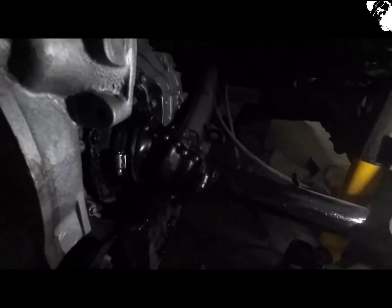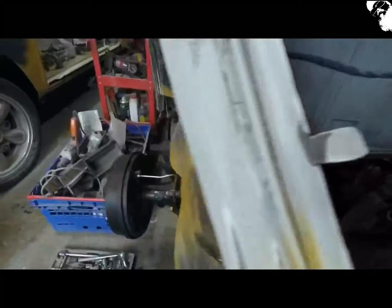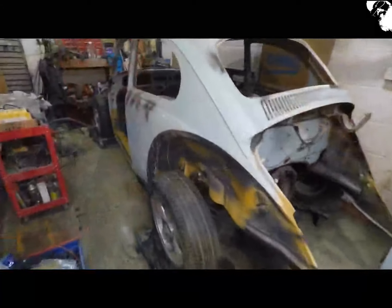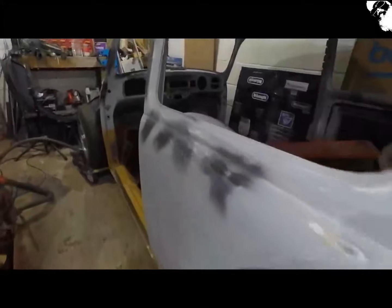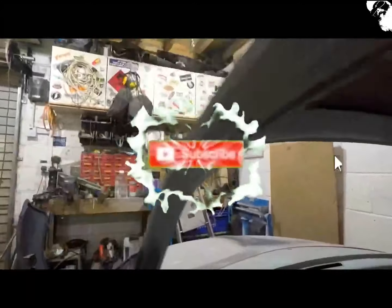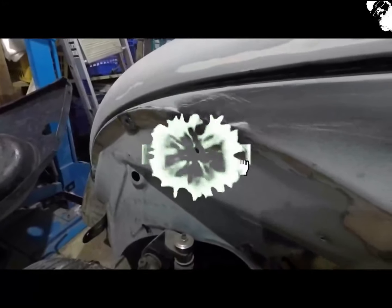I'm going to be honest, I haven't got much faith in them lasting long. So that's all new brake lines and hoses done in the rear - now I'm just going to move up to the front. Looking a lot better - she's now back on her wheels with just a little bit more sanding to do on the inside up on those pillars and just up inside both wheel arches. I've just cut the bolt off of this steering column collar - I'm actually going to pull the column out and the tube so it's ready for paint.